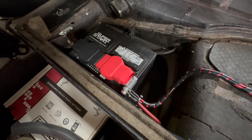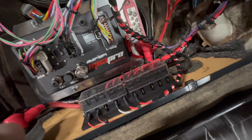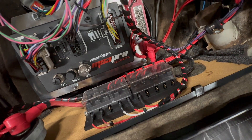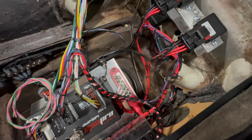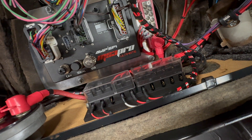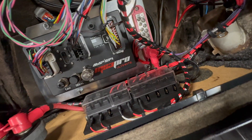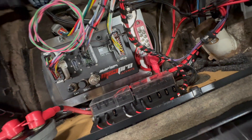There's a big 80-amp relay, a circuit breaker, and that goes back to tie directly to the battery. The fuse panel is located on the back side of the kick panel. Power comes from the bus bar up to the relays and over to the fuse panel, allowing me to fuse all the separate circuits. The main bus panel is fused by the circuit breaker. The bottom side is input power, the top side is the actual load, and some of that stuff is already terminated.